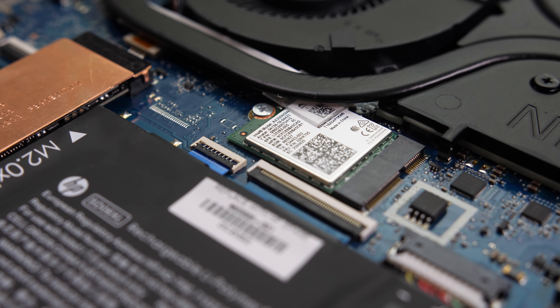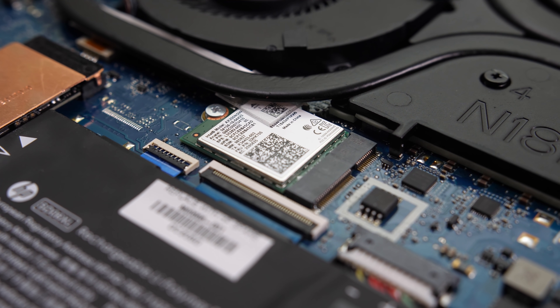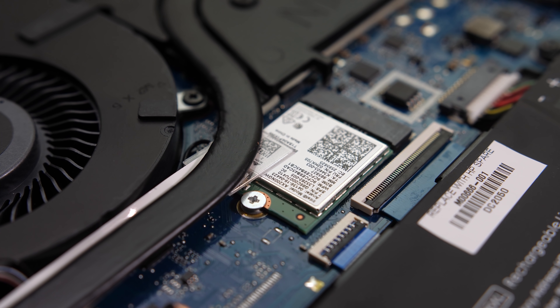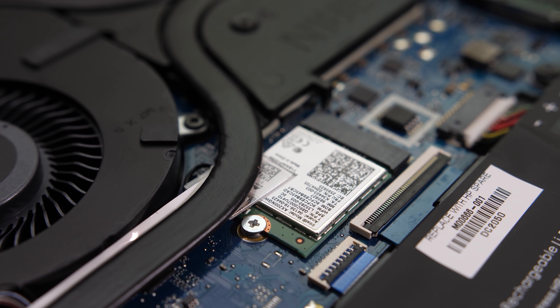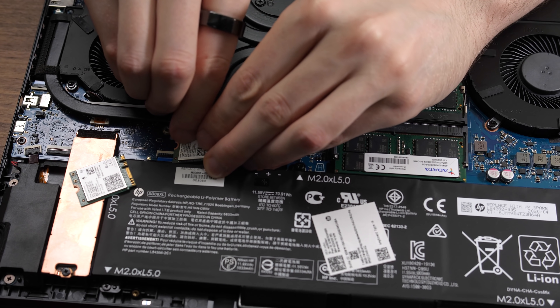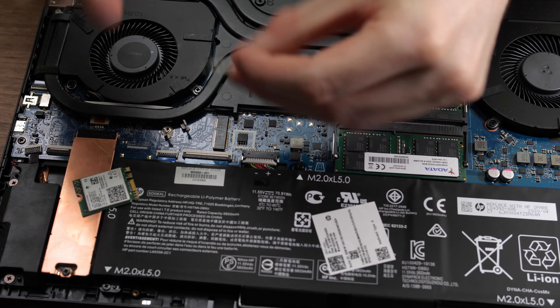Next up we're going to upgrade the WiFi card, or at least try, as you'll see. The Omen 15 already comes with WiFi 6 by default, but WiFi 6E recently came out so I thought I'd try it. The newer 6E uses 6GHz for increased bandwidth, though you won't see a benefit unless your wireless access point also supports 6E. Upgrading the WiFi is a much more annoying process compared to most other laptops, as there's a heat pipe covering the WiFi card, at least for the AMD model — it's soldered on the Intel model and can't be upgraded. I was actually able to swap the WiFi card without removing the cooler as the heat pipe had a little bit of wiggle room, but I can't say I recommend doing it this way. Just be gentle, don't bend the pipe, and if in doubt just remove the cooler.